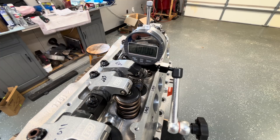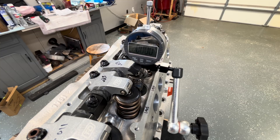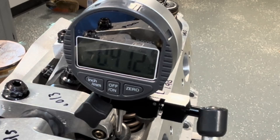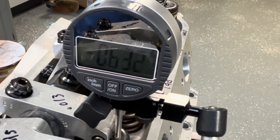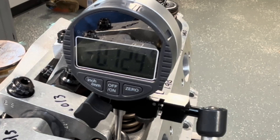So inquiring minds have to know — right now I'm on zero lift, but I've got my gauge preloaded about 850 thousandths. That should be at least a hundred more than what is on the cam card. So I was going to go to max lift. I'm clear around here — it's not touching anywhere. Checker spring is on. I think it says 726 on the cam card, or on the specs that I gave Kuntz anyway. There's 30, 31, 32, 33, and back down.